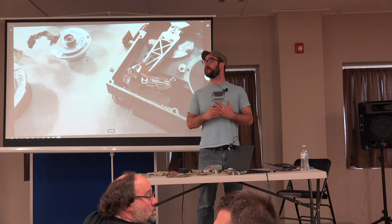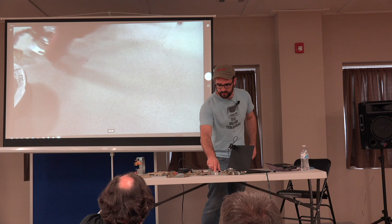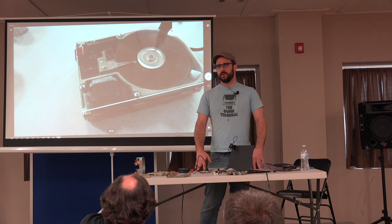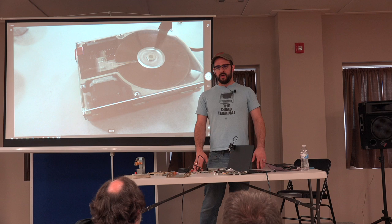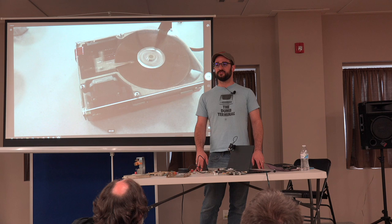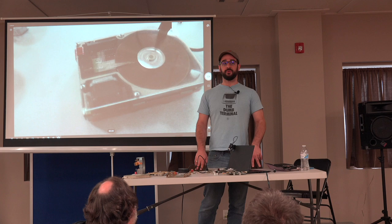Eric. Well, going off of that, are there serious voltage level differences between the two? Like, if you get it wrong, will it blow up? The drive, the controller, or both? So the thing to watch out for, like with those IBM direct bus attachment drives, is that the power is on that edge connector. So you don't want to just shove something in there because it fits. From my understanding of ESDI and ST506, there's no power transmission over those ribbon cables. It's all logic level signaling. So my understanding is it just won't work. That said, I wouldn't try it with something that you consider important.